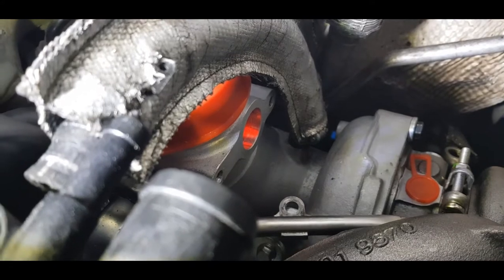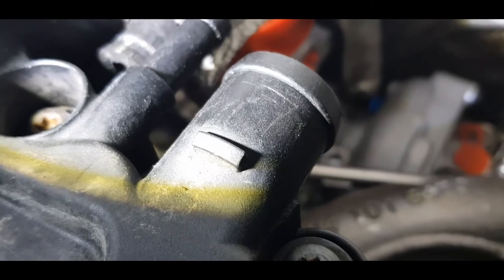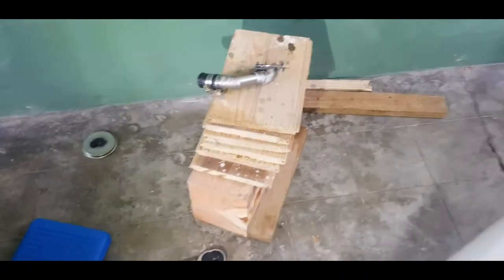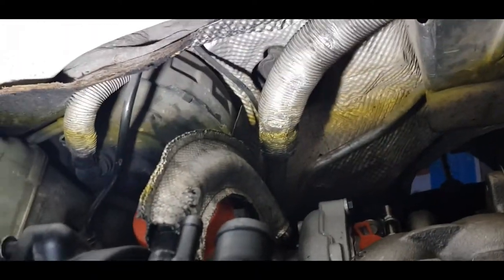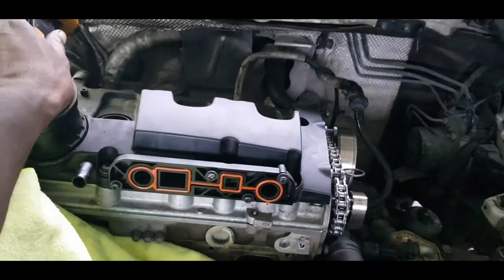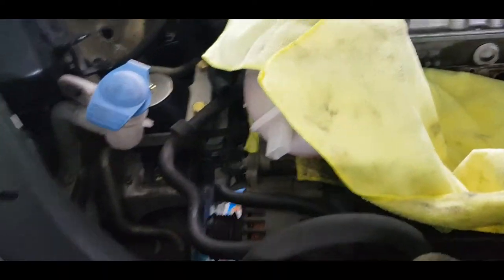One, this rear PCV on the boost actually connects to this piece in the center. It was quite a stretch for this to connect up here via that accordion hose. So that's where we are now. Oh, rear dog bone mount reinstalled and bolted up, so it's just really to reattach the oil line and coolant lines for the turbo at the back.